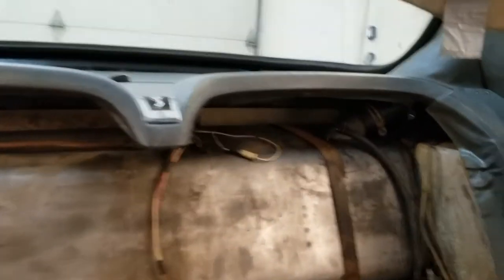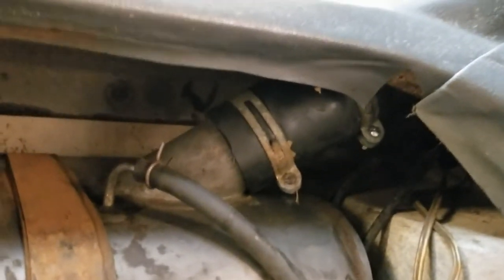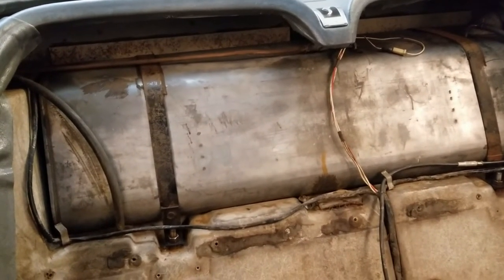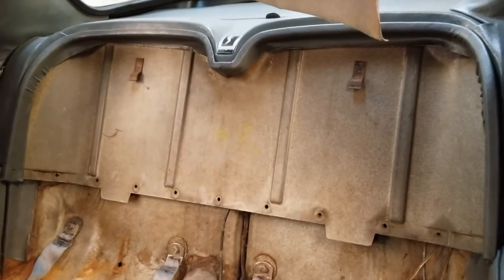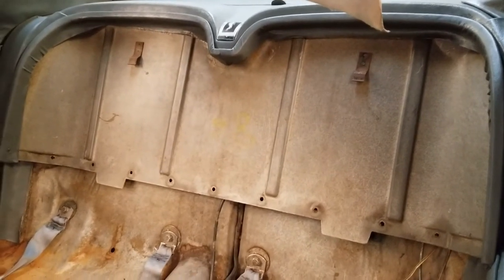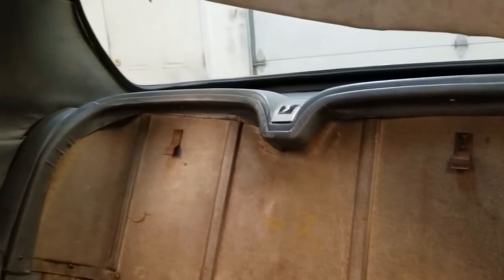Got everything in — the feed hose, the clamps, and the outlet/inlet piece are all hooked up. Got the straps on down and tight, all the wiring is in. Now it's time to crawl underneath, put that fitting back in, hook up a new 3/8 line to it, and get that run into the main fuel line. Now we're getting the bulkhead piece back into position — cleaned up all the leather with leather cleaner, just have to line the holes and get the screws back in.